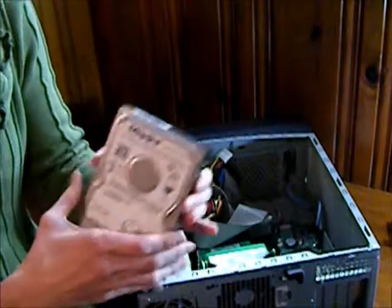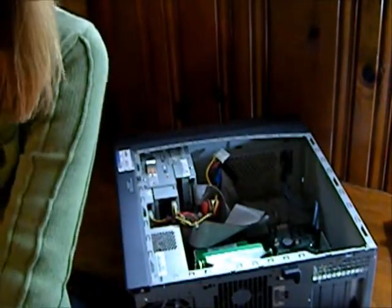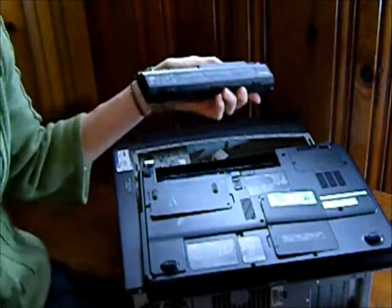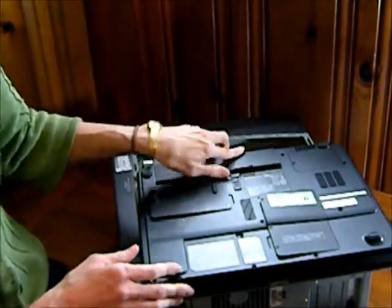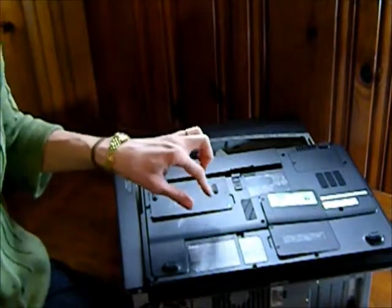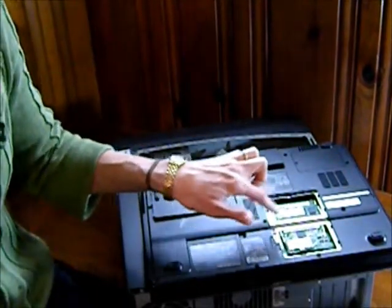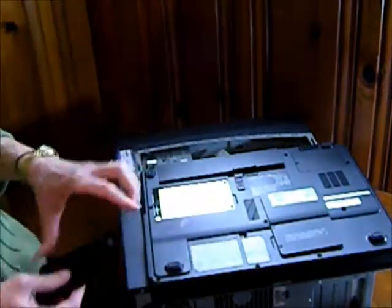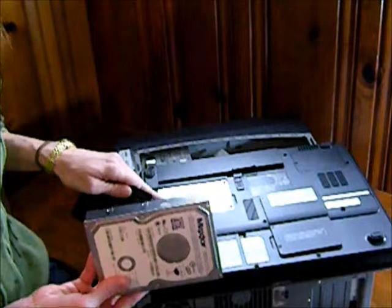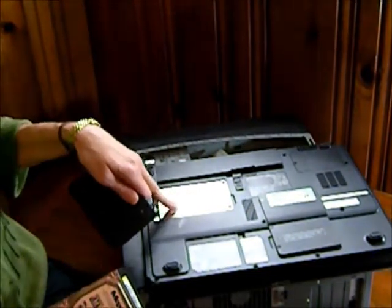You want to open the cavity, look inside, look for something squarish that looks like this. And on your laptop, if you have a laptop, it's the same idea but even a little bit easier. You probably know where your battery is because they look roughly like this, and they usually have a little flip lever so you can take them off without too much hassle. Then you might see another couple of little cavities that are screwed in. I unscrewed one and could see it's got a lot of what look like little circuit boards — that's where the memory is. Then I took off another one, and there's a smaller version of this square drive. So that's what a hard drive looks like on a laptop. You would pop that out, destroy it, and recycle the rest of the computer.